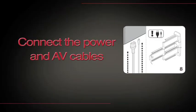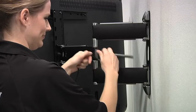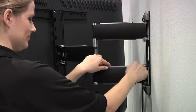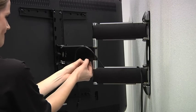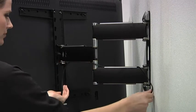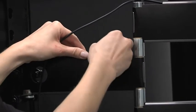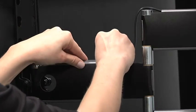For the cleanest, neatest installation, you can route your power and AV cables through the integrated cable management system. Fully extend the mount's articulating arm. If your TV has a detachable power cord, connect it to your TV now. Slide the cable channel covers off the articulating arm. Route your TV's power cord through the bottom cable channel. Route the AV cable from your wall, set-top box, AV receiver, or other sources through the top channel, and make connections to your TV. Slide the cable channel covers back into place — you'll hear a click when the cable channels are in place. Plug the TV power cord into an AC outlet. Avoid running power and AV cables in the same channel, as this may cause electrical interference that can affect picture and sound quality.